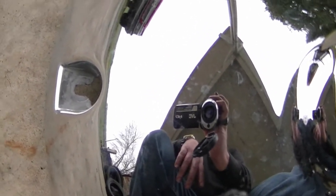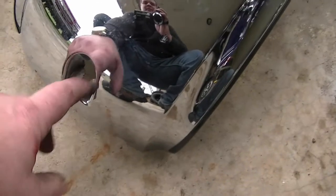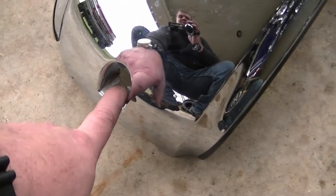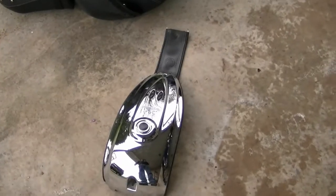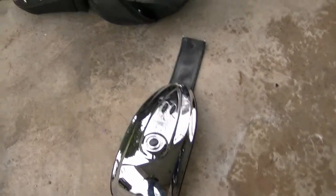You just rock the chrome piece forward until it reaches that cutout, then the chrome just lifts off — the bolt can remain in that slot. When this is on the bike it's hard to get to behind the neck area, so just loosen it. When you put it back on, make sure the bolt is already started. One trick I did: I took that washer and glued it to the head of the bolt so I can just start it and slide the chrome back on without fighting the washer — just set the bolt upside down while the glue dries. A little trick that saves you some aggravation.